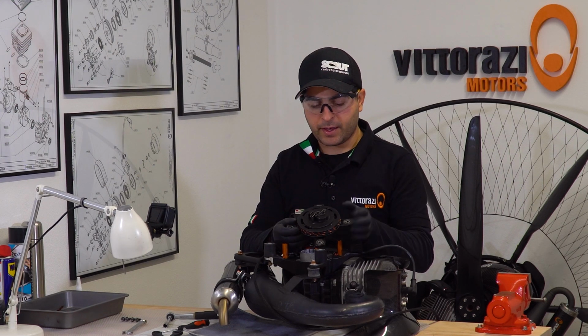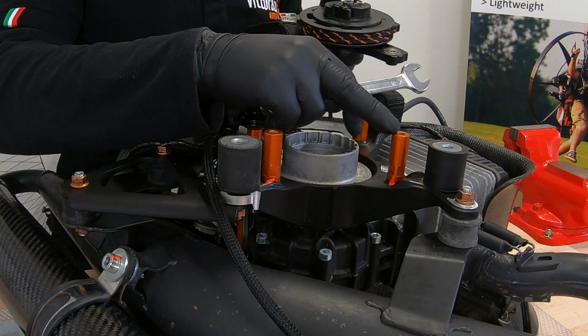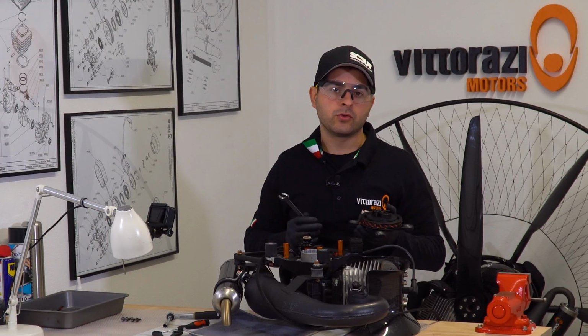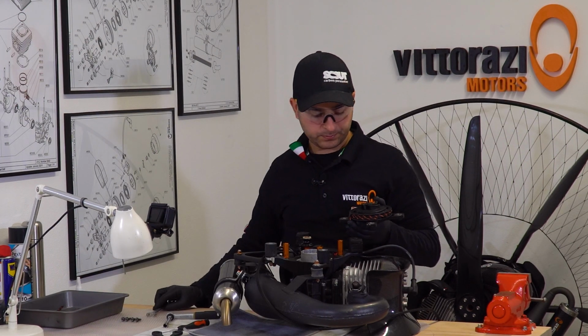The tension in the recoil spring being set up and the new cord in place, now we can proceed with installing the pull starter. But before installing the pull start, please be sure that these spacers are tightened down to the engine bracket, because if they are loose, they can create unusual vibrations and they can break the studs, and after that the pull start will just fall off.